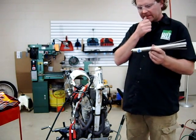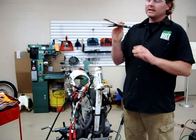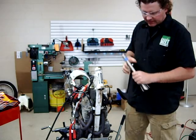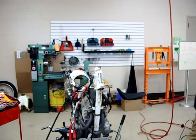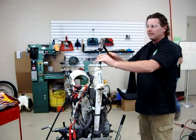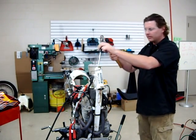This is a tool that's come out in the last few years that's awesome — this one's by Park. What it does is it expands out and takes the shape of the bearing, instead of you just trying to take a big long punch or a drift or something and basically beating the bearing out by catching one edge, flipping it over, catching the other edge, and doing this whole back-and-forth motion.